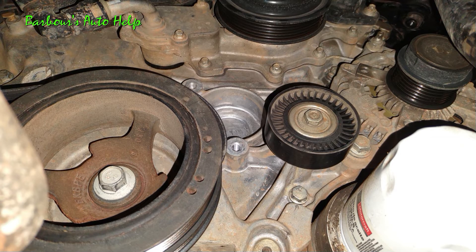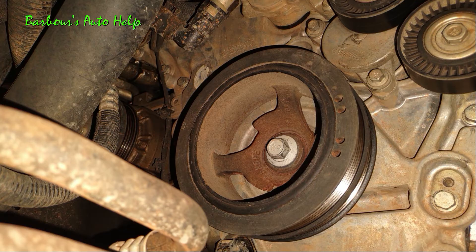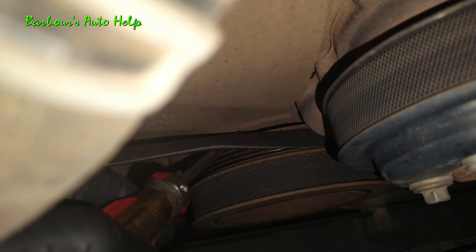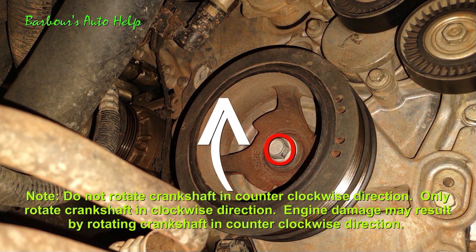Now once that's out of the way, we can turn our attention to the AC belt. In my opinion, the easiest and quickest way is to just take a razor blade and slice it right off. Now a lot of people don't like to do that, or they may want to reuse the belt — maybe they're doing an AC compressor job and the belt is still good. In that situation, you can use a flat blade screwdriver and walk the belt off the back edge of the crankshaft pulley. Put the screwdriver in between the belt and the pulley, pry it back towards the timing cover, then put an 18 millimeter socket and ratchet on the crank bolt, rotate the crankshaft clockwise, and just walk that belt right off.